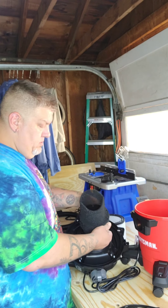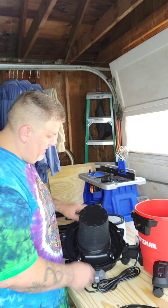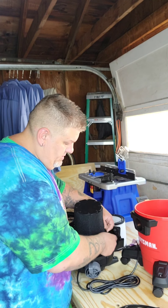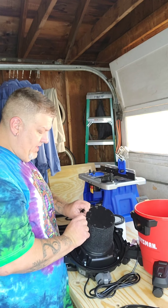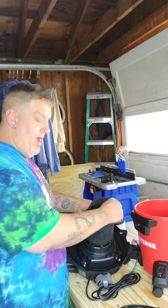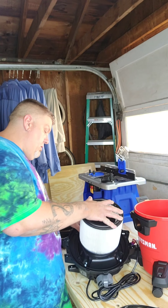This is for the wet operation. You'll slide the foam filter on and in place, making sure that it's all the way down inside. There's a nice lip around here for it to sit on — that seals it really well. This is for wet operation. Anytime you vacuum up anything wet, my recommendation would be to pull this filter off and wash it out really good, because otherwise it's going to mold and mildew. Mold can be harmful — you don't want to get sick because you didn't clean your shop vac filter.